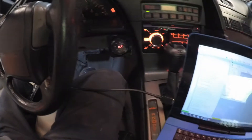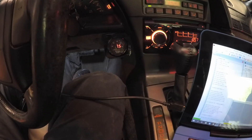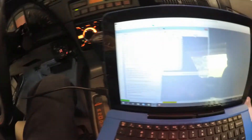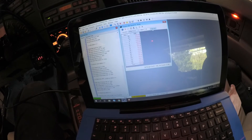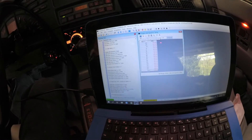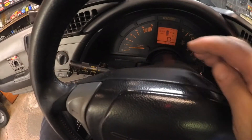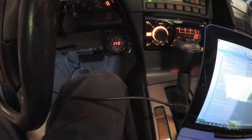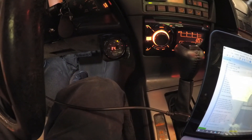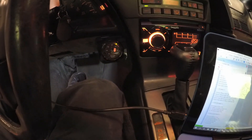We can see the tach come down once I lower it — keep in mind that tach is not accurate. I can see the AFR, so we'll play with that. I'm going to go to the volumetric efficiency table and see if we can enrich that up a bit. I can see I'm a little lean there. Let me lower it — I'm going to go to 625 — and you can see the tach come down. We'll go to the volumetrically efficient table and see if we can enrich that up.